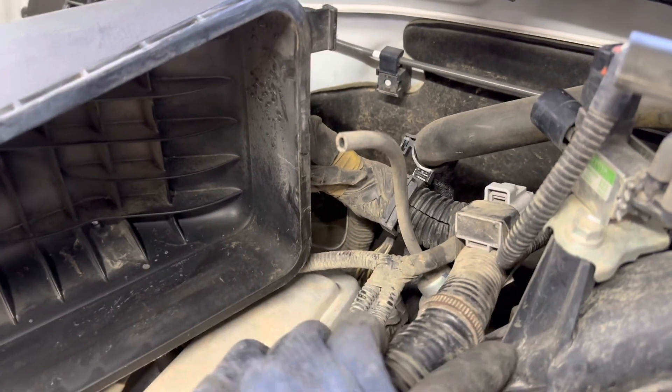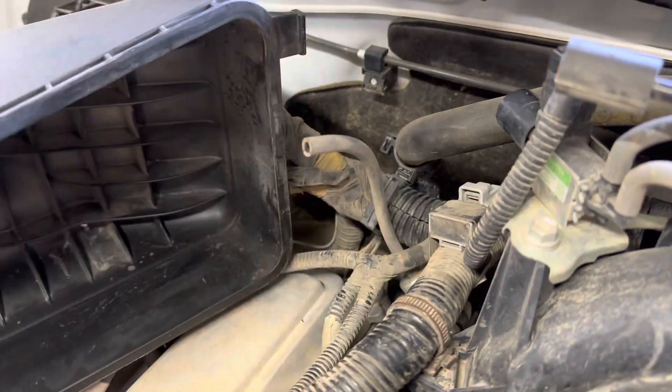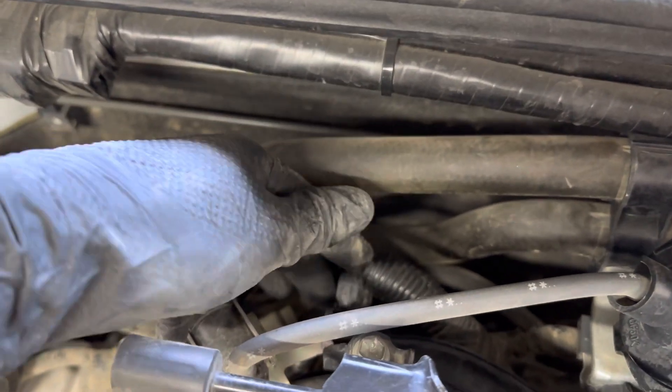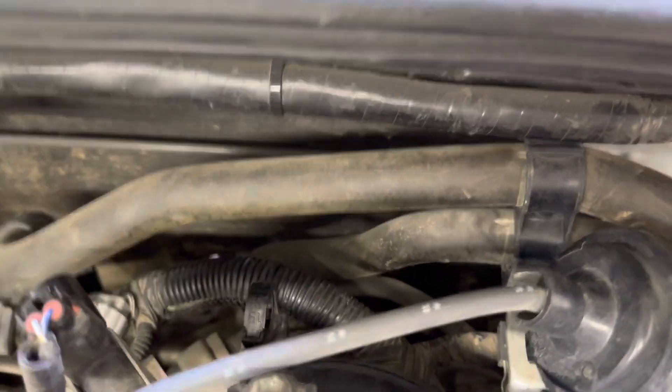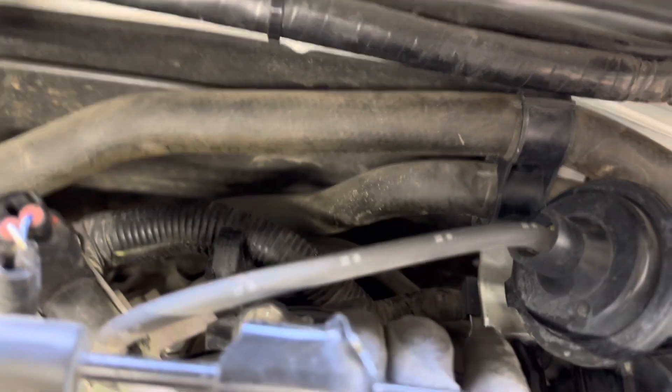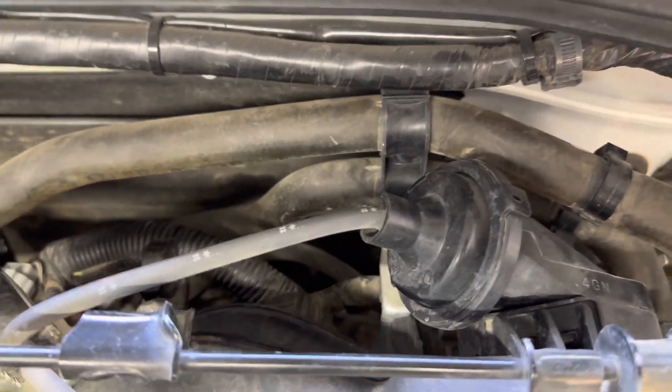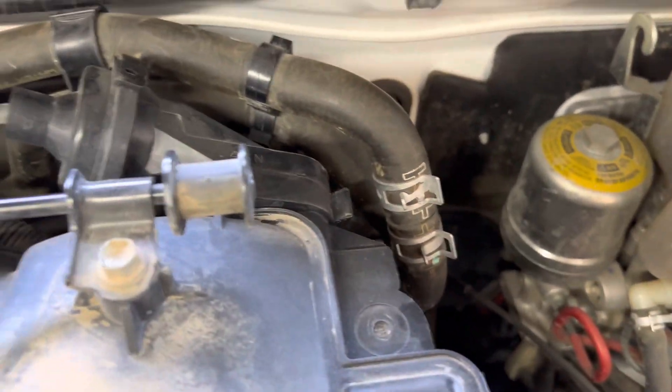The spacer is in and all bolts are torqued. The throttle body is torqued. I was able to get this clipped back into the stock position — this is the hose that goes to the back of the box. I had to leave this harness below the original clip, but I was able to get the 10mm back on these two heater hoses. Make sure you bolt that down so those heater hoses aren't moving all over the place.